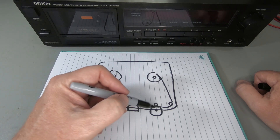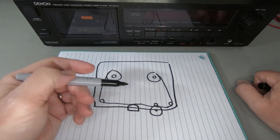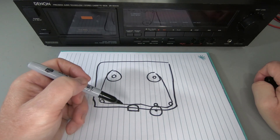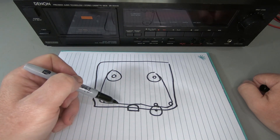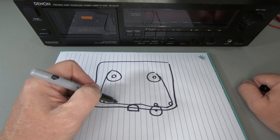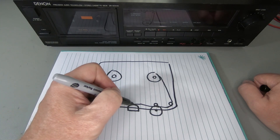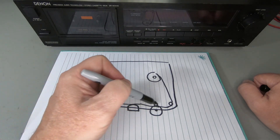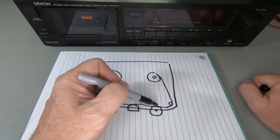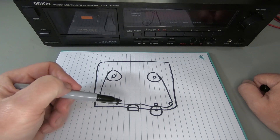This capstan runs at a predetermined speed — it determines the speed of the tape across the play head. What can happen in terms of quality of sound and stability of the music is that the tape here is free to move up and down, so there could be a slight vibration in the tape, just moving up and down. This could affect the contact of the tape on the play head itself. The only point where the tape is actually gripped is here at the capstan, but all the tape before that point is free to wobble and move around.